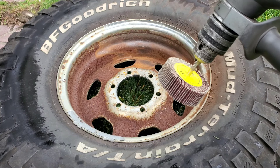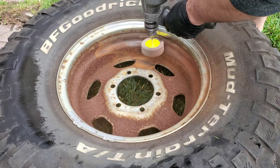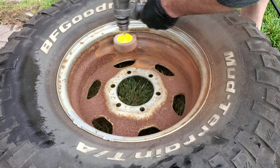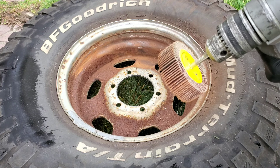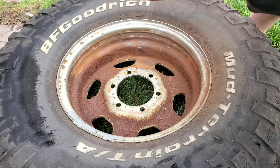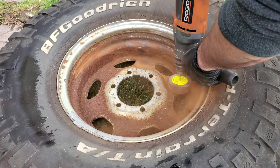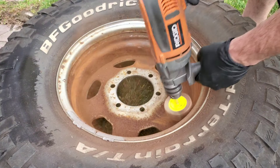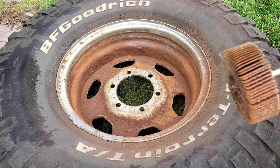It's called a flap wheel - I have it on. I'm sure direction makes a difference here, we'll try it both ways. Actually I like the wire brush much better - this looks good for wood, maybe not metal. There's a little arrow showing direction you need to go. You can see the rust flying, but I would only really use this as an initial pass and definitely finish with the wire brush.